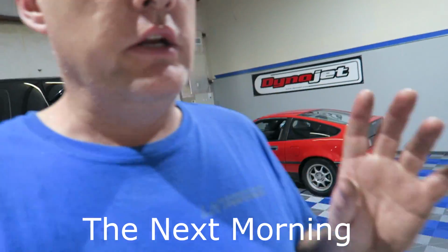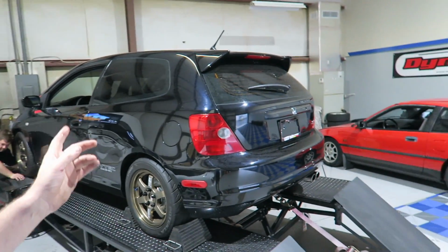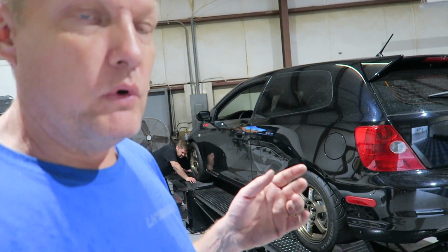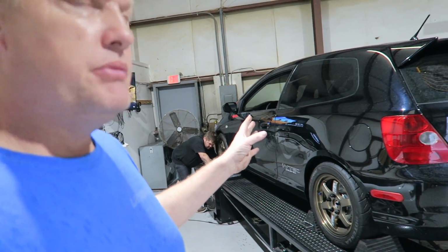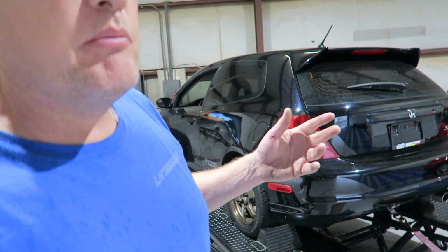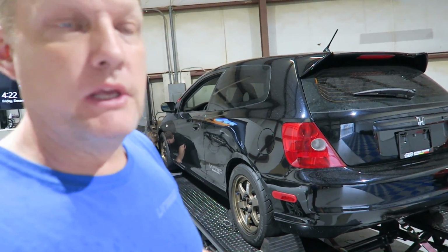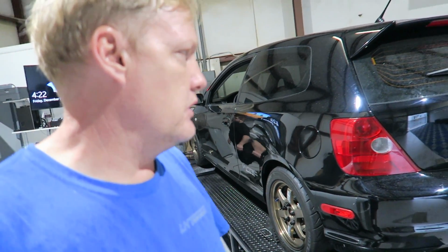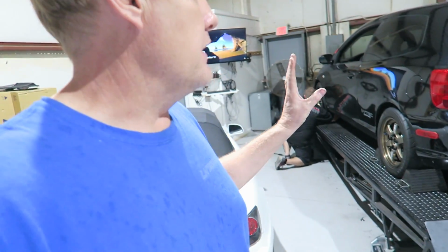Yeah, exactly. All right, so we've got the EP3 on the dyno. I will tell you that the factory map, even though it started and the trims were fairly close, didn't want to run on that map. The EP3 has a VTEC engagement point of 2200 RPMs, and the TSX motor didn't like it at all. I just went to the gas station and filled it up with some fresh 93. So I changed the map. Now it has a factory TSX map in there that we can tweak from,